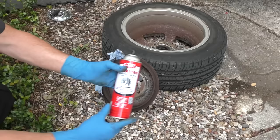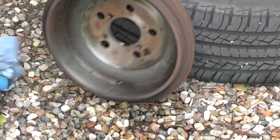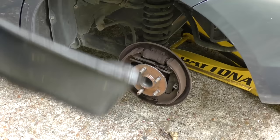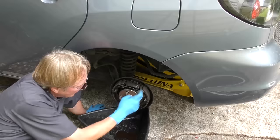As you can see inside the drum, there's a whole bunch of dust. We want to get rid of all that dust — just wipe it into the garbage can. To make sure it's clean, get some brake cleaner and spray the inside; when you tilt it, it'll all go out. You'll notice there's a lot of surface rust, but that doesn't mean anything. The only thing that matters is the inside here where the brake pads touch. Then get a pan and clean the pads and the hardware, all the springs.